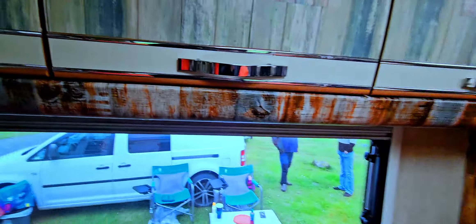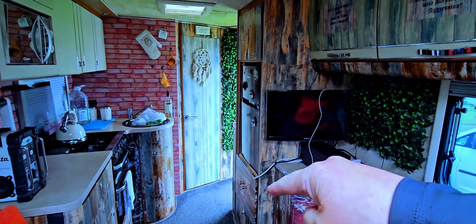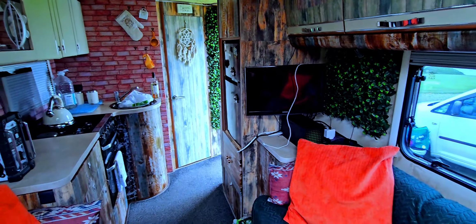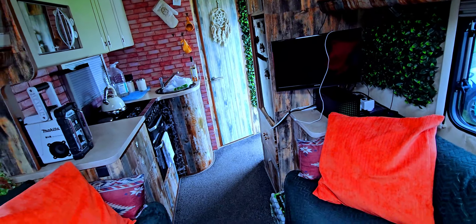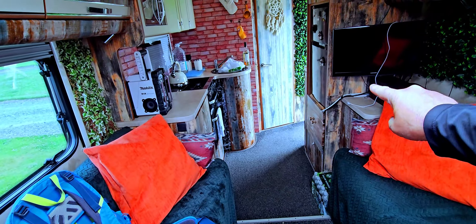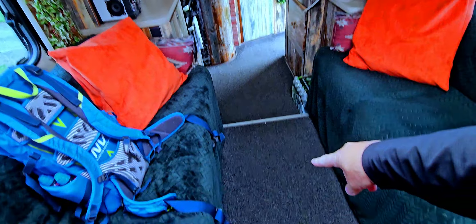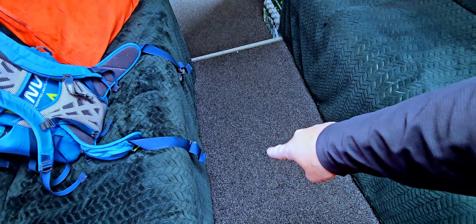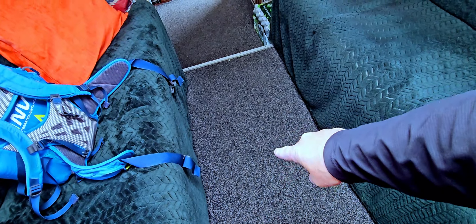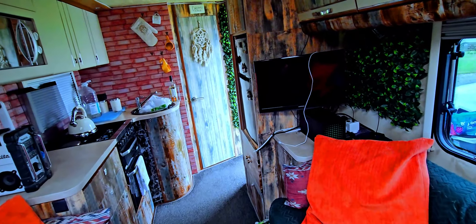The way I can charge this: I've got 600 watts on the roof going into the solar generator when the sun's out — that's putting power in. I've also got the EcoFlow Delta 2 Max solar generator and the backup battery, which is 2 kilowatts of power. And I've got two leisure batteries under here — 140 amp hours — and another two leisure batteries on the other side. So I've got four leisure batteries and two lithium phosphate batteries. I've got tons of power.